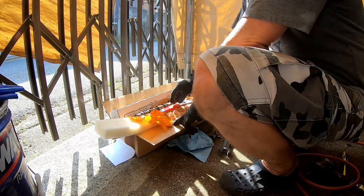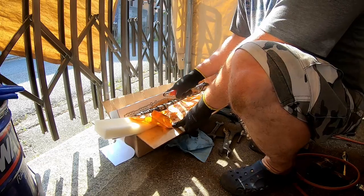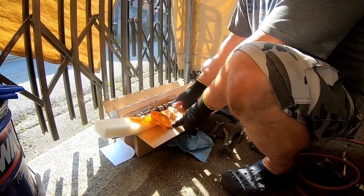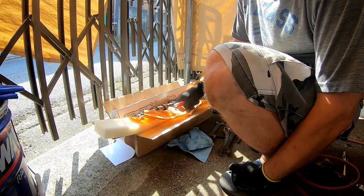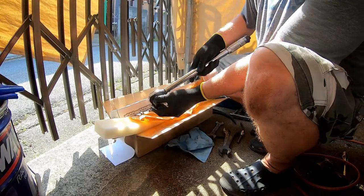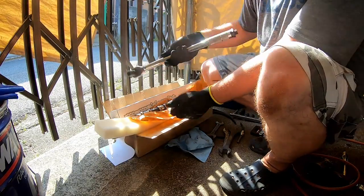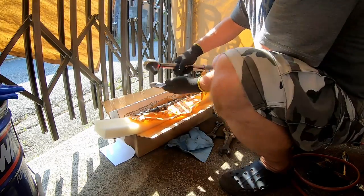Just down here on the box, I was able to use a shifter. This piece on the Toda cam is actually bigger than the OEM cam. Be aware, this is 25 mil and the OEM cam is 24. It's a 14 mil torque wrench on the other end, set to 42 newton meters. Do it up and you're good to go. Not difficult to do, just don't forget to do it.